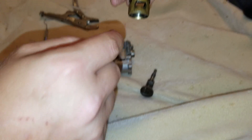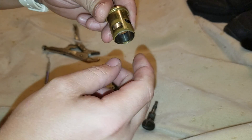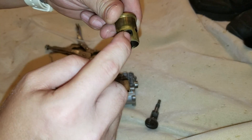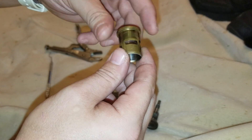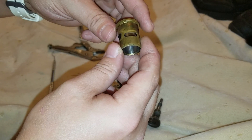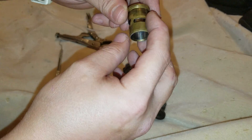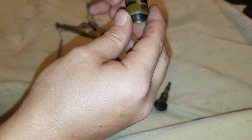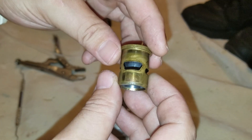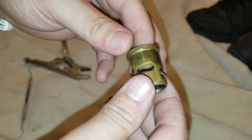Here's the exhaust port — first to open. Side ports. Boost port. So that's how they all work. This is just a three-port intake, one-port exhaust — a three-port design. Racing engines like Novarossi and LRP have seven ports for intake; you get a lot more power. Of course, the more fuel-air you get in, the bigger the explosion and the more power.